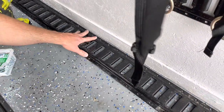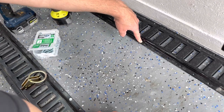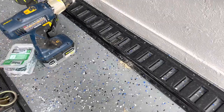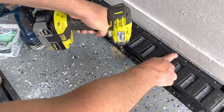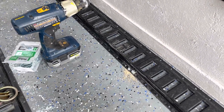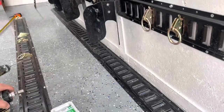Here I'm at a section where the end of this five-foot section ends and the four-foot section begins. There's a screw right here, but these are actually spaced too far apart to hit the metal stud. So I'm going to have to drill a new hole here and a new one there so that both of these are going into the metal stud. Even though I don't have a hole there on the e-track, you can drill one out pretty easily. I'll have to do the same thing on this other side and keep working my way down.